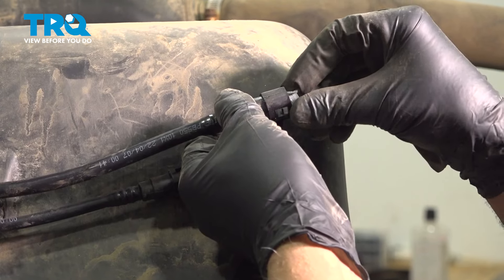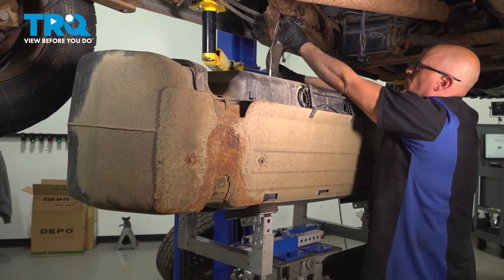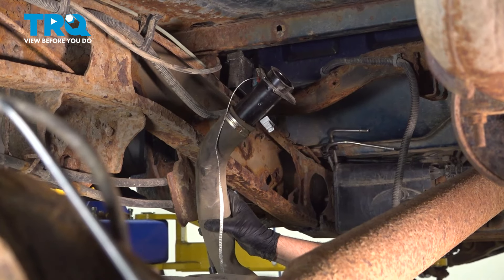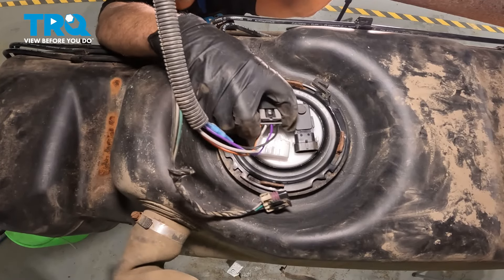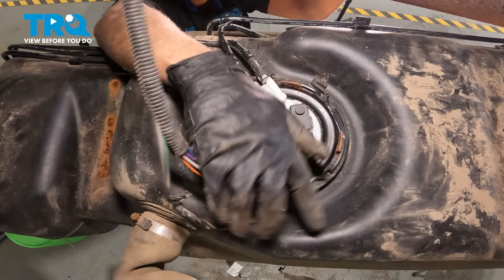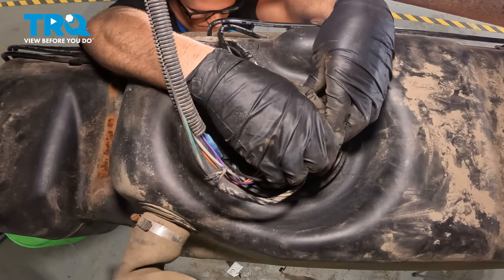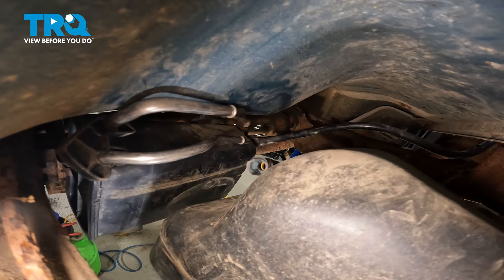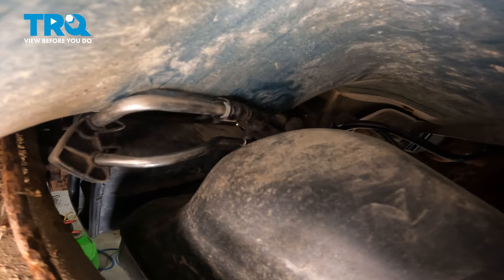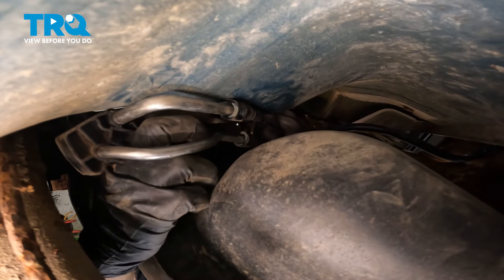Now you're good to put the tank back up. Attach these to the hoses — just push those in, same with this one; push it in and lock it down. Go up with the fuel tank — just make sure you grab the filler neck and have that go up first. Once it's high enough, connect the connector to the fuel pump — line that up, lock that down, push down on the lock. Connect the fuel tank pressure sensor and lock that in. Connect the fuel lines before you push the tank all the way up — makes it a little easier. Those are locked in.